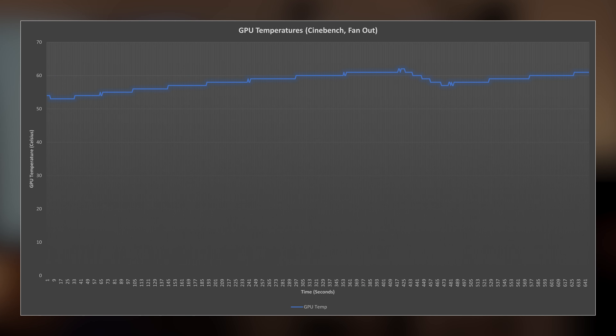I think part of this is that the CPU fan blowing in gives us a cooler PC in general and blows a lot more of the hot air inside the case out. With the fan blowing into the case, GPU temperatures start around 44 degrees Celsius and get to underneath 60. But with the radiator fan blowing out, it starts above 50 degrees Celsius and gets above 60 degrees Celsius. This GPU temperature readout shows that the heat inside the case is just not going anywhere — it's lingering around when the fan is blowing out.